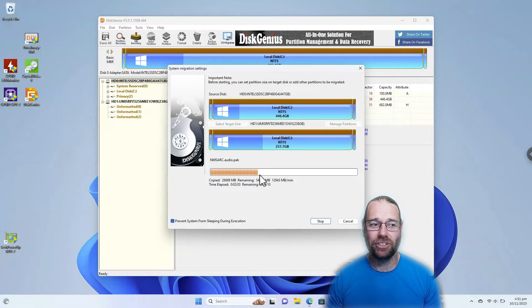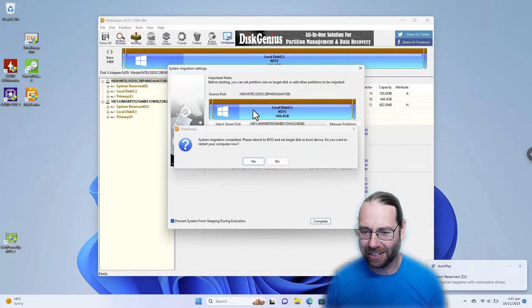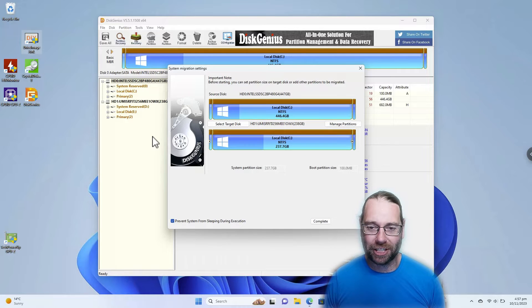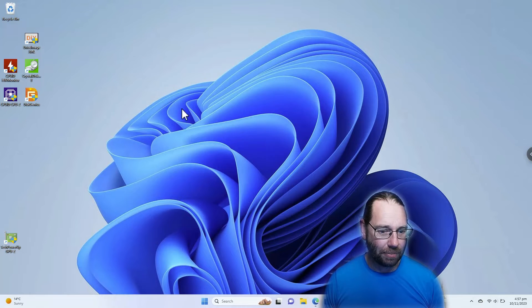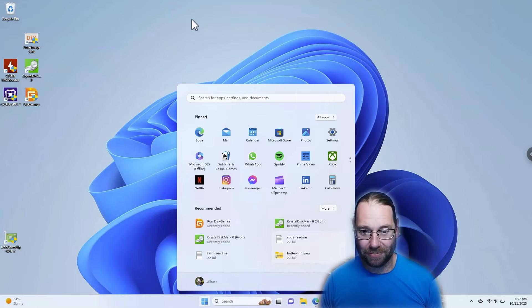So we'll come back to this when it's done. This is now very almost done — we've got a few seconds remaining. I used to use lots of different software for copying boot drives, but a lot of that software is now commercial or their free aspect has expired. Do I want to restart the computer now? I'm going to say no. The other bit of software you can use is Drive Image XML — it didn't actually work in this case because the drive is smaller. And the other possibility is Clonezilla. So complete — and I might just reboot it. Hopefully it will boot from the NVMe drive rather than the SATA drive. Let's go restart. I'm not certain that that's the case.